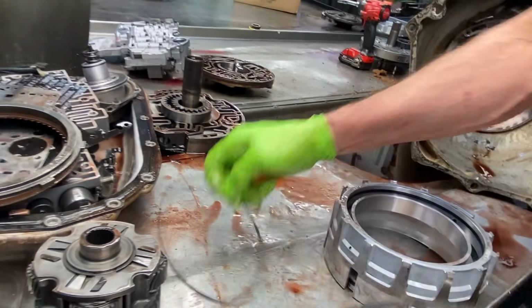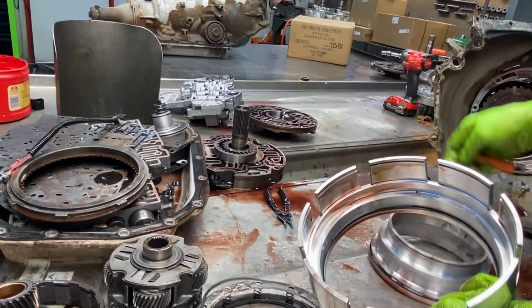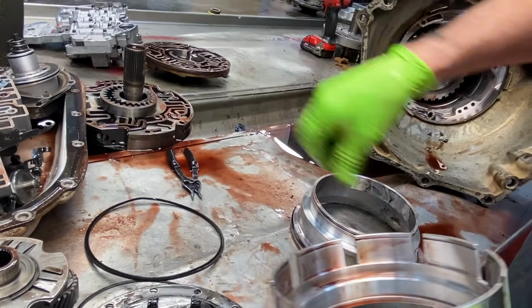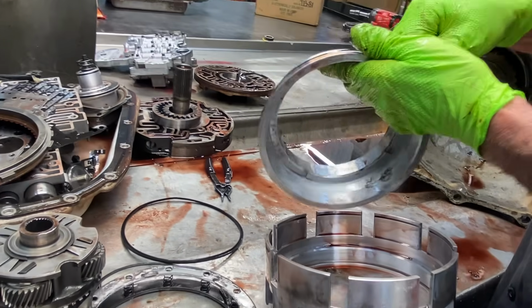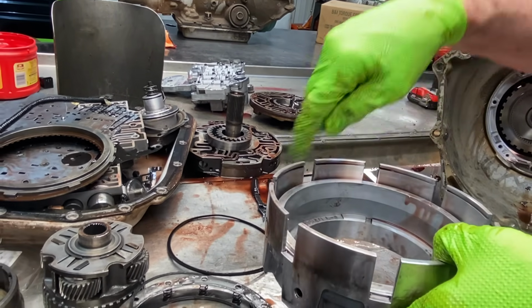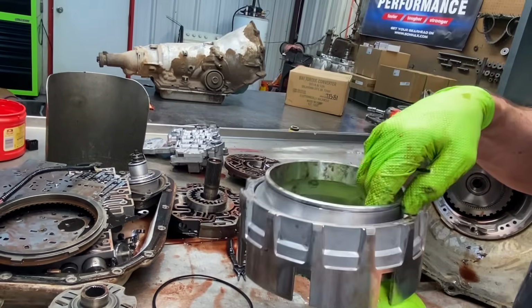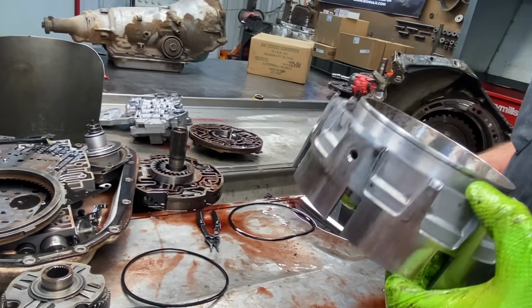And it's not so much getting this snap ring in there, it's getting these two seals that you got here. You got one here, and then you got one here. When you're putting these together, you got to set them together. You got to take your knife, scribe, and go around it this way, go around it this way, and try to get it to work. Once it pops in there, it'll look just like this.